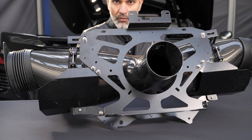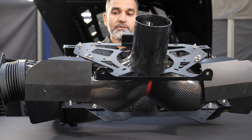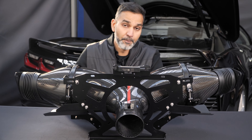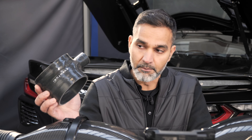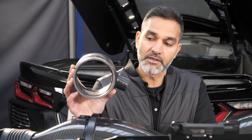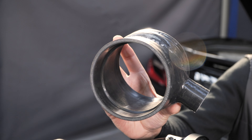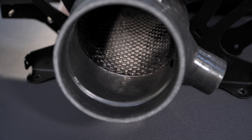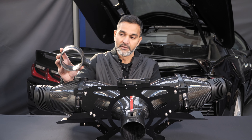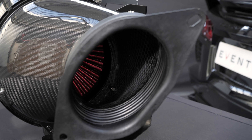If I turn this further around, you can see two flat panels — those are heat shields to prevent radiative heat from affecting the intake when it goes over the exhaust. The final component is obviously the silicone coupler, which connects the back of the MAF tube to the throttle body. This is a custom-made silicone coupler, and importantly the inside of that has been designed to keep things as smooth as possible. You can see there's a lip and a raised surface for the throttle body and the intake to sit inside, so that the actual inside faces have no steps to encounter. So everything once it's fitted is nice and flush internally, and the airflow can go through a continuous tube without seeing any flat edges.